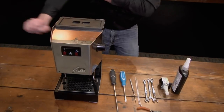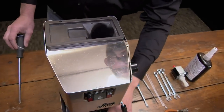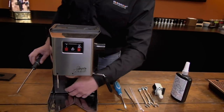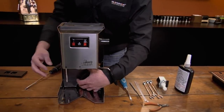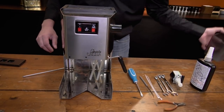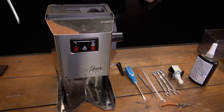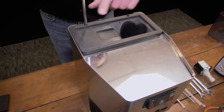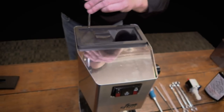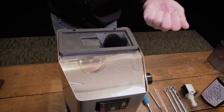We're going to go ahead and open up the top of the machine. You're also going to want to remove the accessories — pull the tray out, set that off to the side, and then pull the tank out. Actually, we've got to pull this tube out first, just get that out of the way because we're going to be working with the hose down here. Then we'll take out the two screws on the top, which are the only screws that hold this top plate in. Unscrew them — and if you don't have a magnetic tip, it'll be a little bit more difficult.